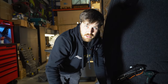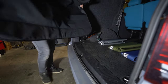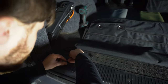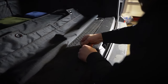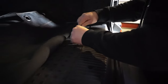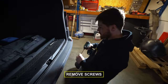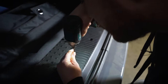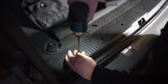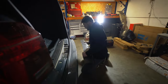Let's get it installed. First thing we do is take off our threshold strip. I'm going to grab a pick here to remove the caps - in this case a very thin screwdriver will do the job as well. Let's pop the cap up to expose the screws and undo them. I've got a Phillips screwdriver attachment - some are T20 - but we'll undo these now.